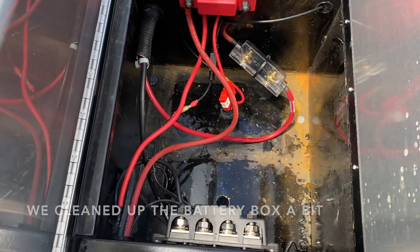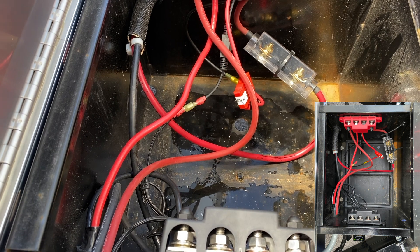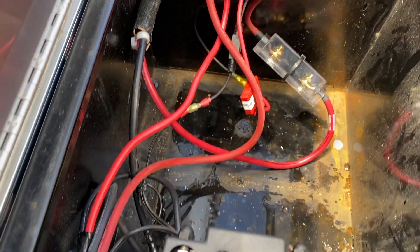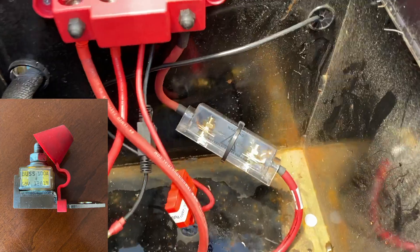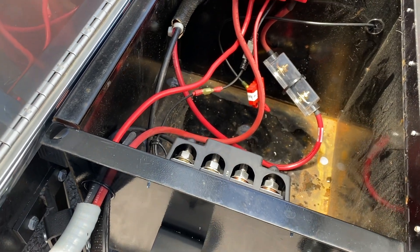The other thing I'm going to show you — I've already done this in advance because it's not fun to watch — I ran a four gauge cable for the new lithium battery. I didn't do a video on removing both batteries because it was just long and tedious. What I ended up doing is I've got a positive and a negative bus bar and I just repurposed every existing wire in there and mounted it. They come with a 100 amp fuse attached to the AGM batteries, and I replaced it with this sealed one right here. That's very important.